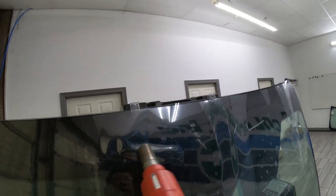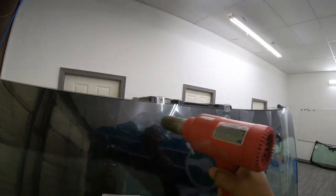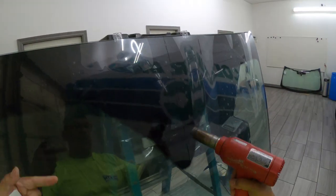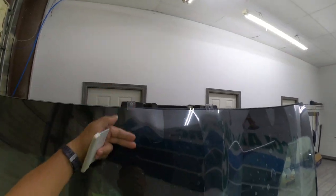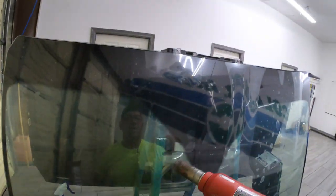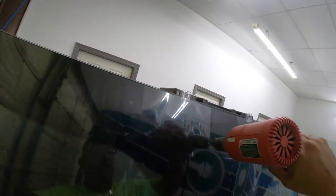I think you can see what I'm doing. Attack it the same way. Make sure it's saturated with plenty of liquid. I'm going to go about here, re-wet the window when done, scoot this down and finish my shrink here. Everywhere else you're going to see me go ahead and continue doing it all the way to the edge the way that I should.